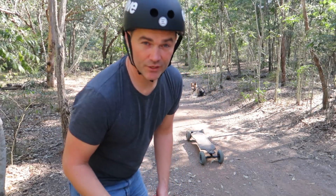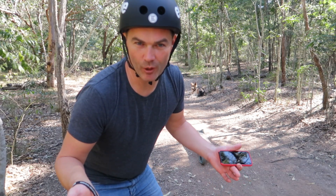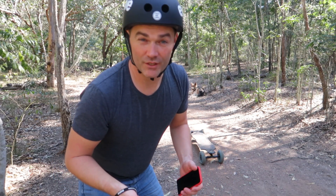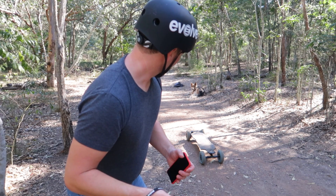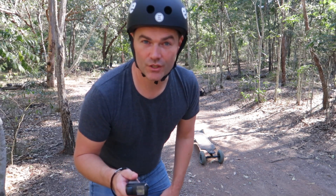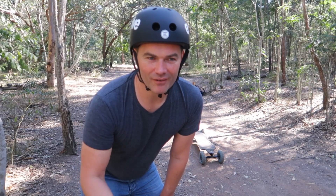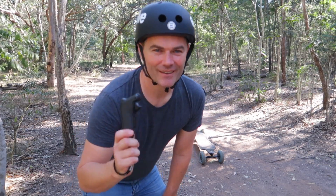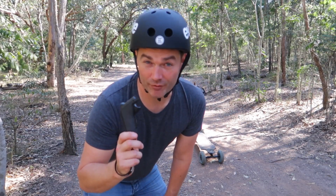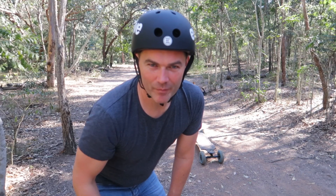So I just did a quick calculation — it's not really worth talking about the eco mode, it stopped from about 16 km/h, or 10 miles an hour, in about three meters. And for the fast and GT modes, it was about 28 feet, which equals about eight meters. So if you're cruising along on the dirt at my weight and you're at about 25 km/h, you've got to allow at least eight and a half meters to stop. Super aggressive of course you can slide it, but just on the brakes alone, about eight and a half meters.